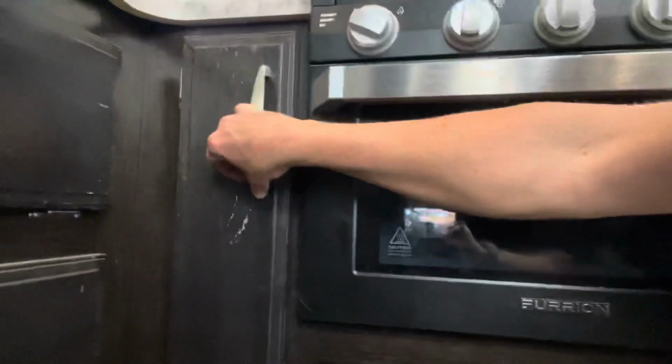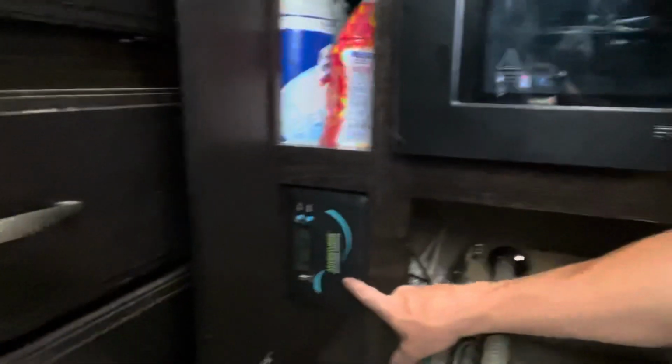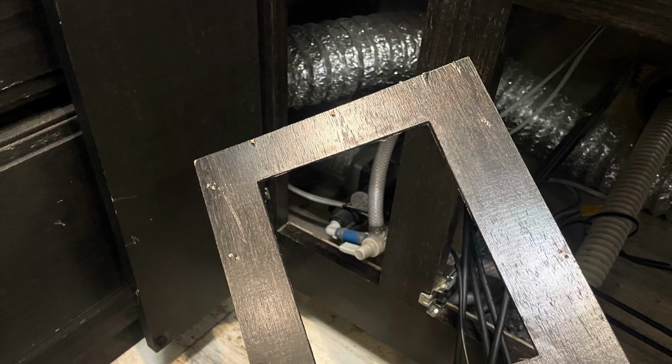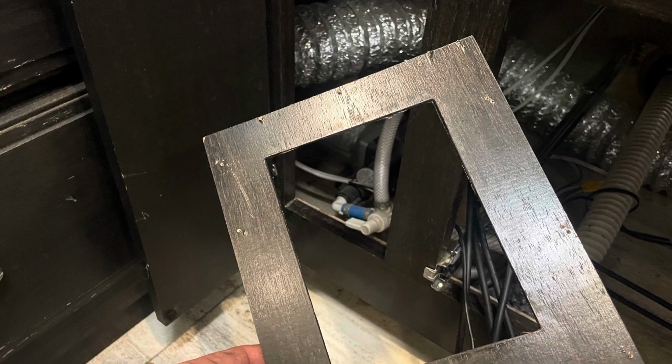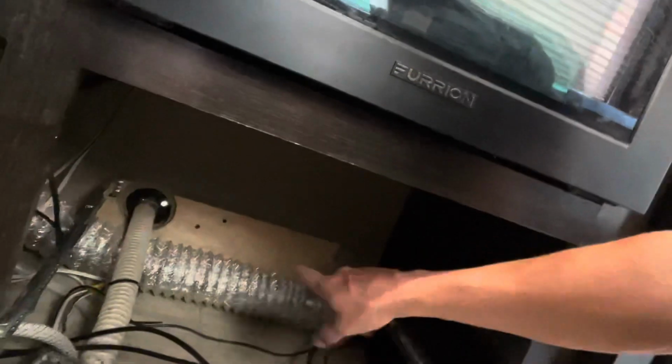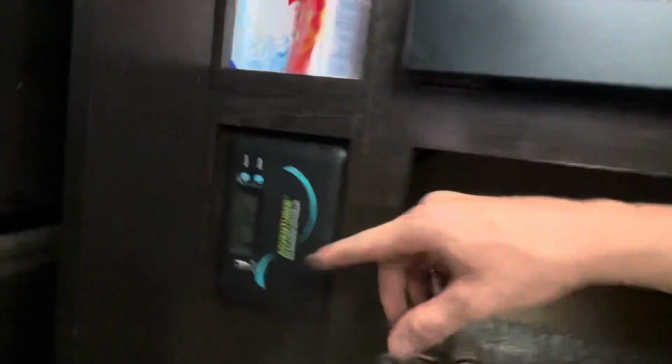It's just a goofy little cupboard, but I took this panel out, I measured the controller, I took my laser and laser cut the wood out, and it's going to go right there. So I ran the panel wires down where I was going to run the battery wires, up underneath here. I can just coil it here and the controller there, and it's already on the battery and sitting at about 13 volts. Just a little trickle charge setup going on. So that should do me.